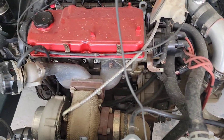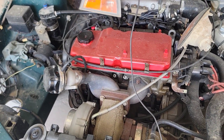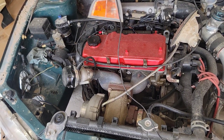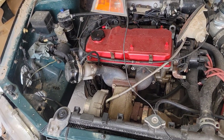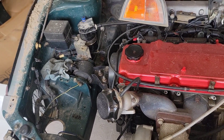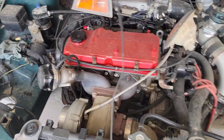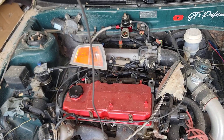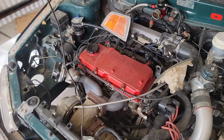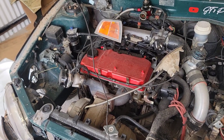The spark plug wires are just removed and the plugs are just loose — I was checking the compression on this one. Cylinder number two is low, it has about 30 PSI while the other ones make about 170–175. Previously I had already replaced the timing belt on this side, installed the cam seal, the crank seal, the main seal on the bottom. Today's the day we start working on it. I have all the parts I'll need, so hopefully this should be a few hours, not a few days.